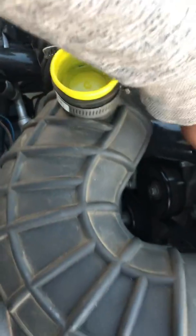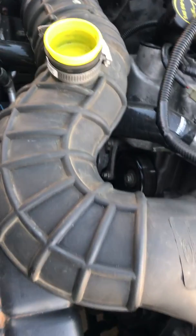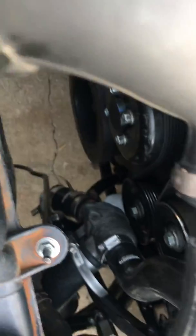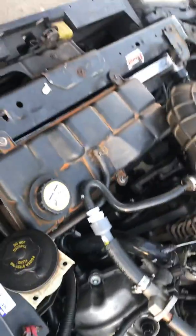Since we have two coolant crossover lines coming out, these are kind of different on every engine you get from 2005 to 2010. We went with the 96, 97, 98 Cobra thermostat housing, which could be the same for a Mark VIII or some other vehicles as well.